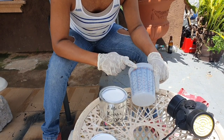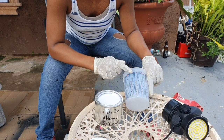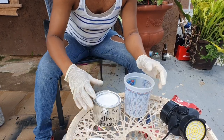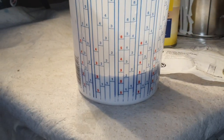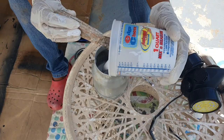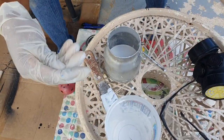Without this cup, I would have just put four quarts of white, one quart of reducer, and one quart of hardener — that was how I was planning to do it. I've poured the paint, now I'm pouring the hardener, and after that the reducer. Make sure the measuring cup is on a flat, level surface. Now I'm going to mix it and pour it into the spray gun.